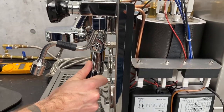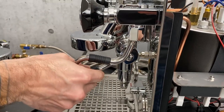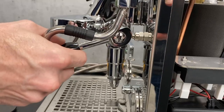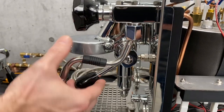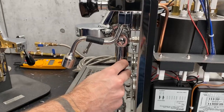She's on. Middle position — pump's not activated. And here we go, we've got water running through, and I get all the way up to the top before the pump comes on. That's perfect — that's what I want to see. You want to be able to have that pre-infusion without the pump coming on. It's all about changing the position of that switch.